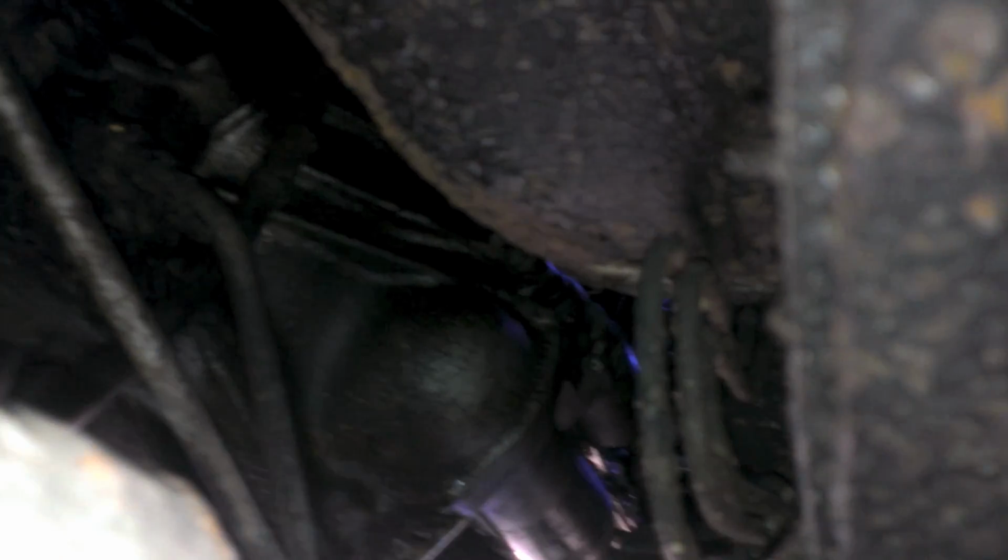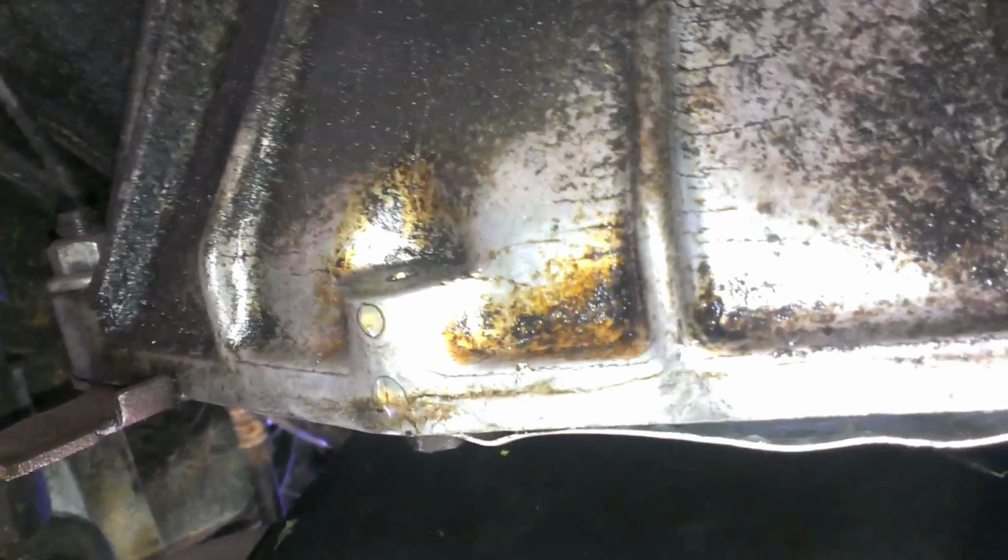And then, after all that's done, behind the bell housing, there should be a freeze plug that's rusted and needs replacement. So, yeah, I did check. It's water, not oil. I smelled it. I felt it. It looks like water. It's very clear. I know I have new oil, but it looks more like water than new oil. Also, I'll have to check. I think that's a broken exhaust bracket, because my drive shaft hits the exhaust bracket when I turn right.